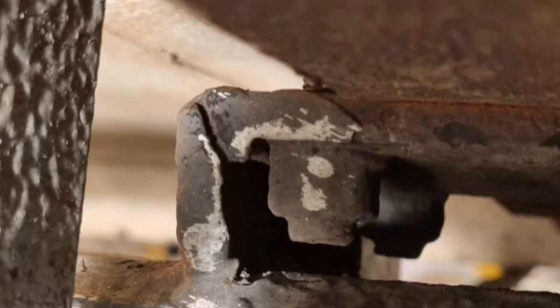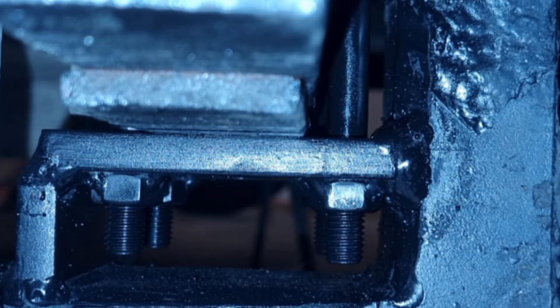The caravan is back, and I'm really pleased about that. We've now got new wheel bearings. The springs were re-tempered, and the bracket — which had a little split in it — was actually a cutout from where someone had a grinding wheel in there. That has been completely replaced with a steel bracket, originally about 6mm thick, now upgraded to 10mm thick where the spring actually sits on. The nuts on the inside have been welded to that bracket, so now it's all lovely and secure.